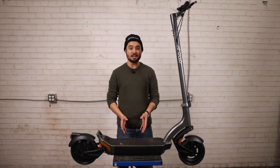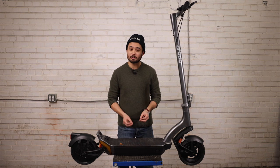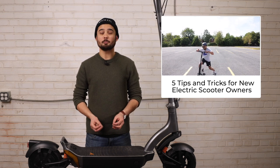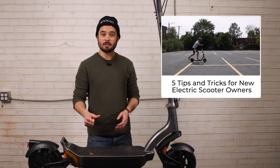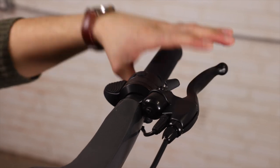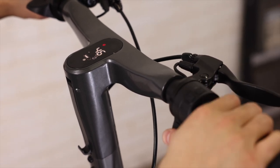It's now time to take your scooter out for its maiden voyage. You should have already purchased a helmet and basic safety equipment before riding. Even if it's not legally required in your area, it's always a good idea to be safe rather than sorry. Take your scooter out to a quiet and empty area with lots of space to get started. Find a comfortable position to place one of your feet first, then slowly push off and gently apply the accelerator at the same time and place your other foot. The scooter is in zero start mode by default, meaning you don't have to push yourself forward to get moving, but it is best to do it this way until you can find your balance and feel comfortable riding. Pushing off also helps maximize your range as the scooter doesn't use as much power to get started. If you want to permanently change the kickstart mode, you can also do it within the Apollo app. Now that you're on the scooter and slowly riding around, you can get a feel for the brakes and determine if they're calibrated to your liking. While riding, you can press the power button to cycle through the different gears or speed limiters to find a speed you're comfortable with.